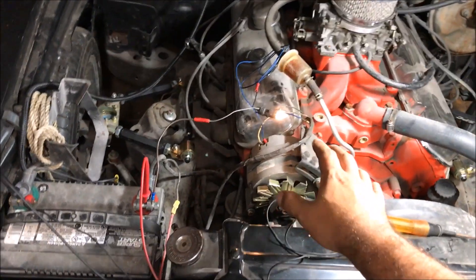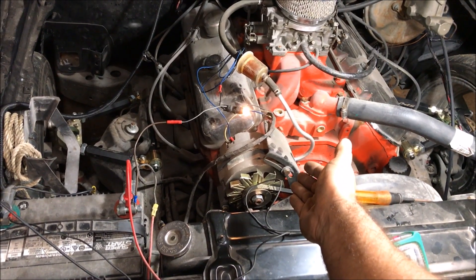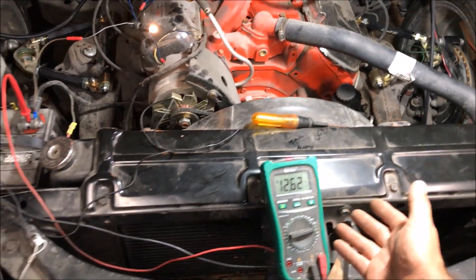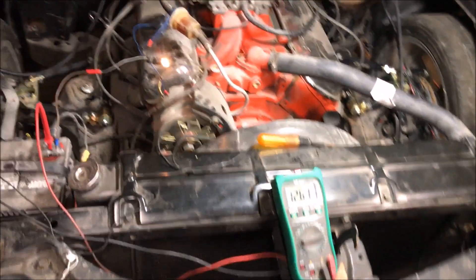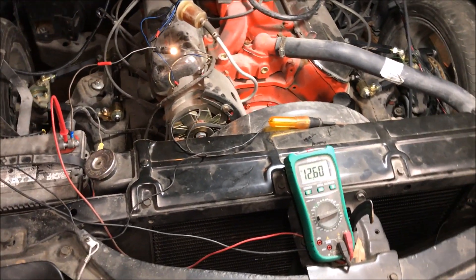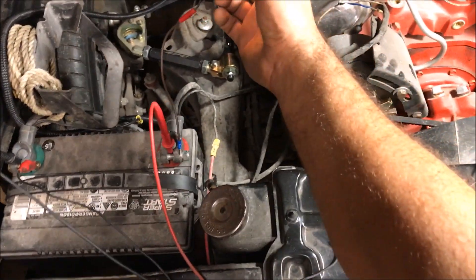The whole point of this update video is to show that there is no 'kicking in' — the simple fact is you don't have the fields energized. It starts charging at any RPM. It's very important that you turn all your lights on, radio, AC, whatever you can, and make sure that thing is charging. We don't even have any lights or radio on and it's charging at 13.09 volts — that's way too low. That's a remanufactured alternator. It needs to be taken back and tested or exchanged. I'd say above 13.5 to around 14-point-something is what I'd consider normal.